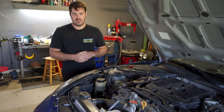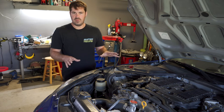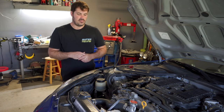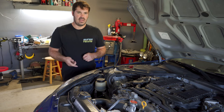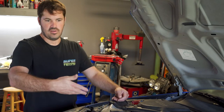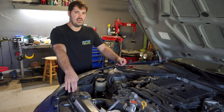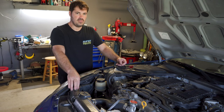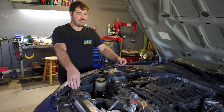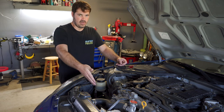There's really no downside to it, but if you want to put it in a factory configuration like we attempted to do for my build here, you definitely need the HR lines from the donor car as well. I'll also mention that I still have the factory DE radiator support in place on my car, and the air boxes do fit with the DE radiator support — so you don't have to have an HR radiator support to run HR factory air boxes.